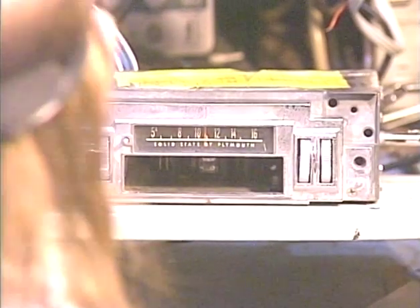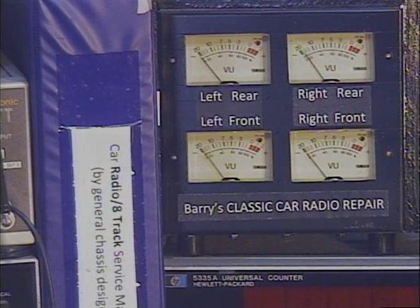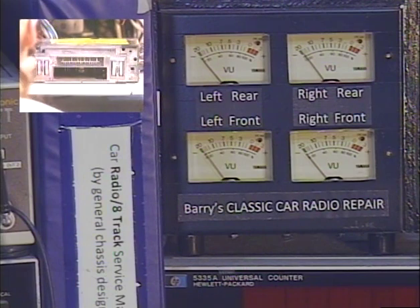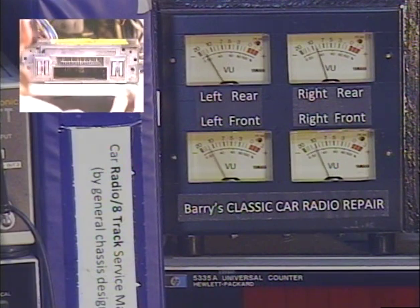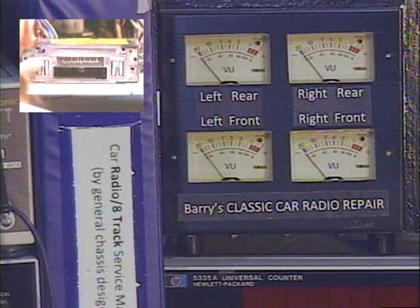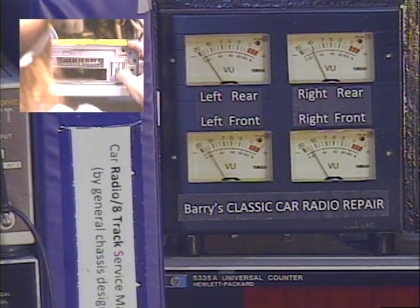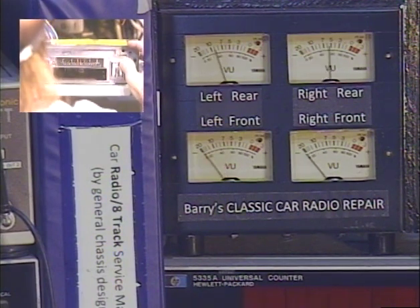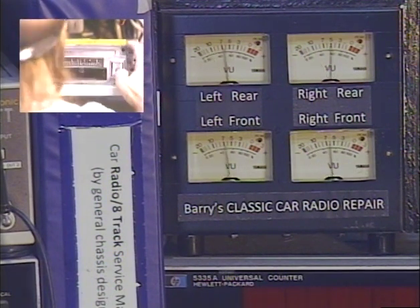This radio also has a virtual front-rear fader. We're going to bring our output-level meters into the picture so we can see the results of our adjustments. To activate the virtual front-rear fader, we rotate the tone control twice upward. Because this unit has Bluetooth, you'll hear a female voice say 'fader adjust' when it successfully activates. I'll rotate the tone control to about center position so I have room to rotate upward. Front only. Rear only. Front only. Rear only. Okay, centering the speakers — that one beep lets us know the setting is saved. This is just a tone control.